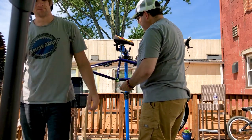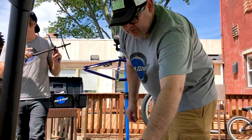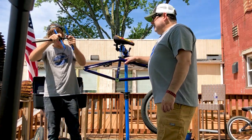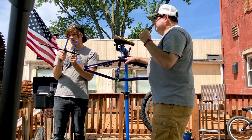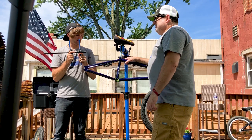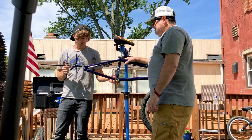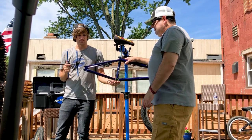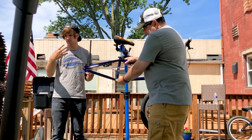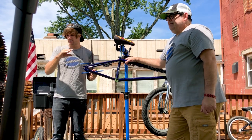On the flip side, to put your cranks back in — if you're replacing your bottom bracket — do not use a hammer. Come to the bike shop, ask them to let you use the press tool or bring it in and have the bike shop do it. You can mess up your entire bike if you put these in wrong and mess up the seating for your bearings. If you hammer it in there crooked, your bearing is never going to sit tight. It's very important that these are in straight.